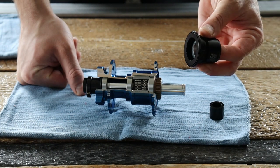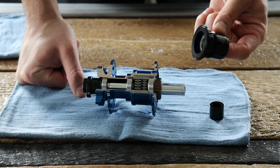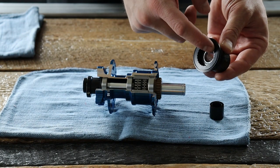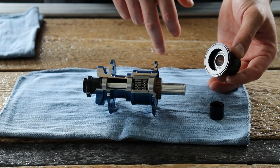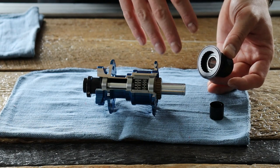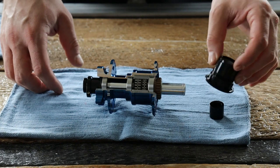This is where you can interchange your freehub bodies — to the hyperglide, the micro spline, the Campagnolo, or the XDR. These freehubs will have a layer of marine grease within the splines, and you'll see the residue of that on the driver body itself when you take it off. If there's contamination there, we do suggest cleaning it and re-greasing with a good helping of marine grease.